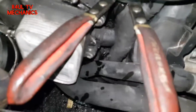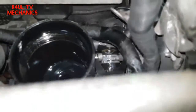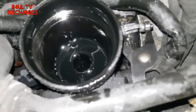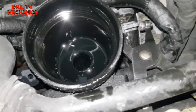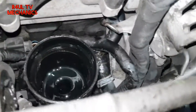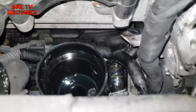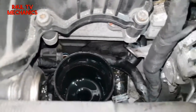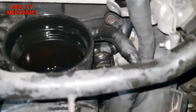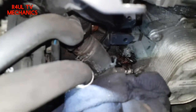After that, you can see that coolant water pipe there — I've got the pliers on it, going to take that pipe off. The clip's off as you can see. I'm going to pry that pipe off, or you can just leave it on for now and when we take the oil filter housing off it should come off with it. We took the clip off the pipe and we'll just leave it there. Now we're going to take these Torx bolts off.